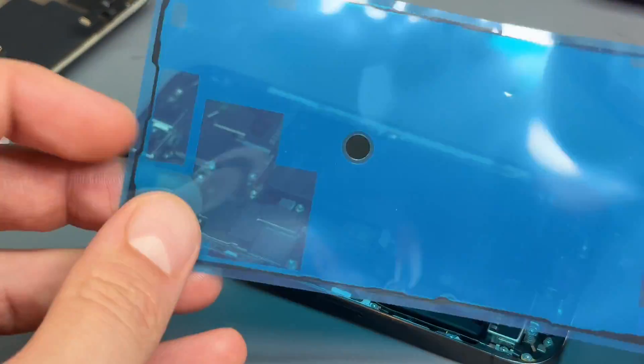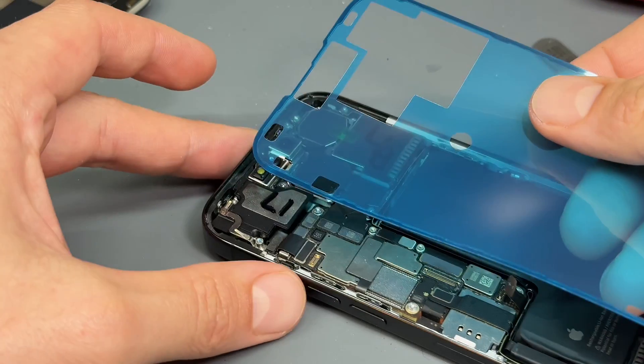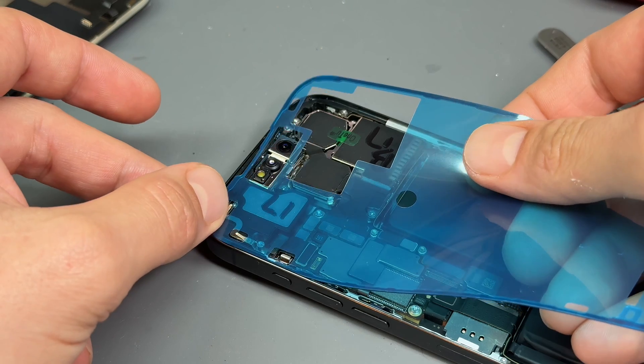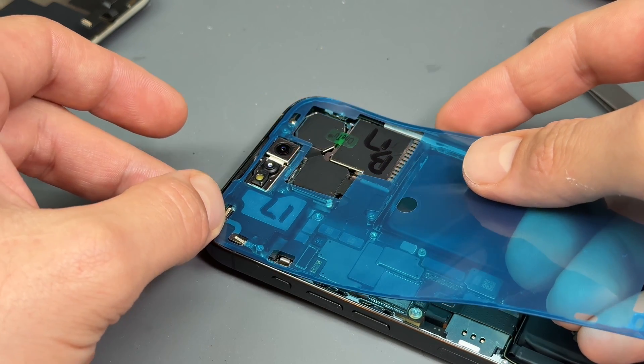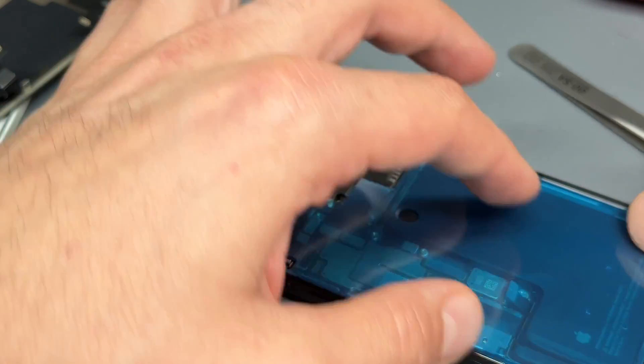You can use a cotton bud or a clean room wipe, but you just want to get right in and give it all a good scrubbing deep into the edge and make sure that it's nice and clean. Work all four edges with the isopropyl alcohol. You'll see why I didn't stick that little bit of mesh on — I'll put that mesh back on just there because I would have rubbed it straight back off. Now that it's clean, we're going to get one of these seals. Don't mistake it for the back cover seal — it's a little bit thicker and it won't fit properly. This is a front glass adhesive.